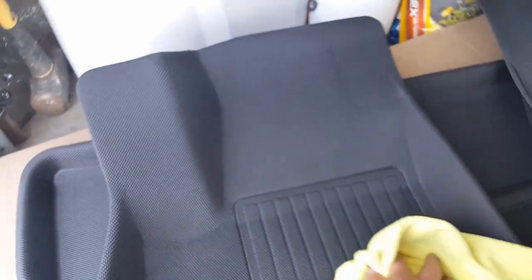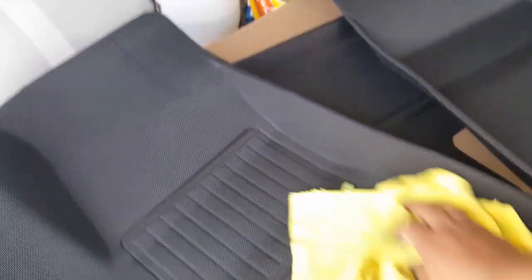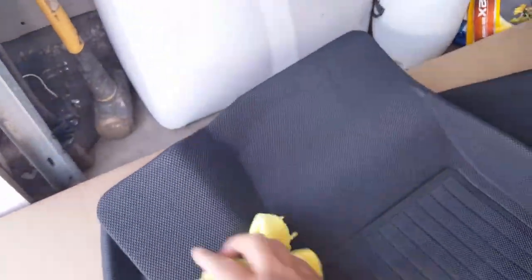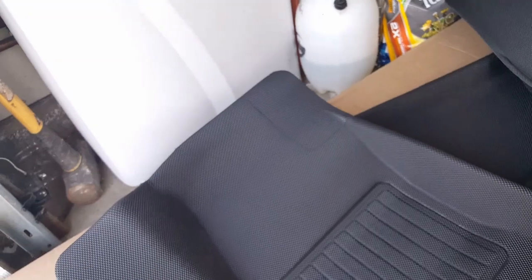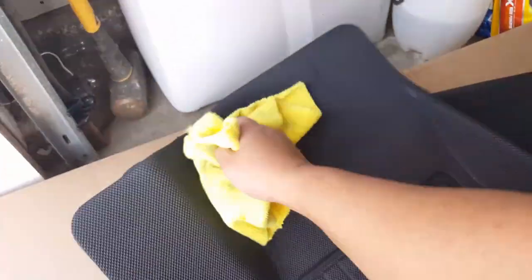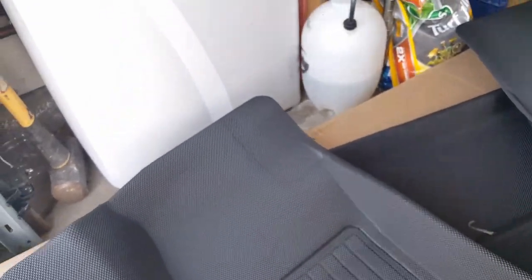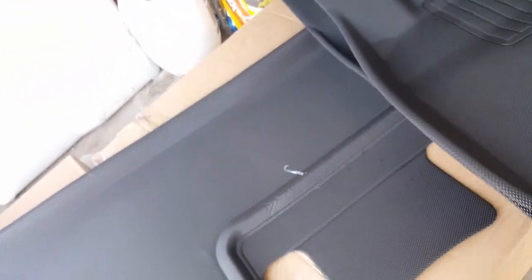So yeah, if you want to apply PPF, do it right. You probably just want to use soap and water, because soap just creates a slippery solution, but it usually evaporates out. This one will leave a little thin film of slippery wax to protect the surface of your cleaning area, may it be your paint or the interior of your car. It cleans it, but also applies a light wax that might create a problem if you're trying to apply some kind of vinyl or film. That's why you use an alcohol rub to dry it, all the dirt and everything, preferably. But like I said, since it's a small little fixed area, you've seen it, it's still pretty much kept the adhesive strength on there. The wax wasn't overpowering, like a constant oil base or anything like that. So yeah, you can definitely use a citrus cleaner for that case. You're not stripping out ceramic coating or anything like that. You can definitely just use a citrus base.